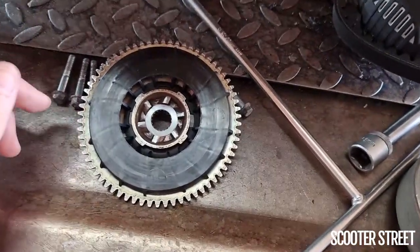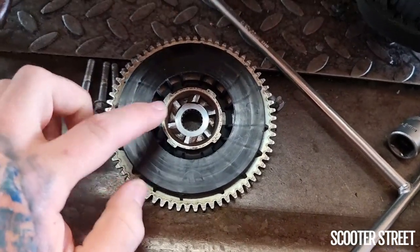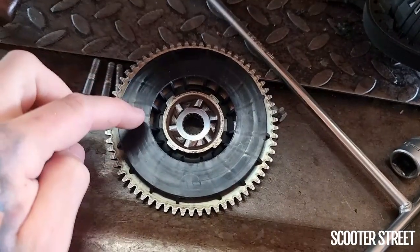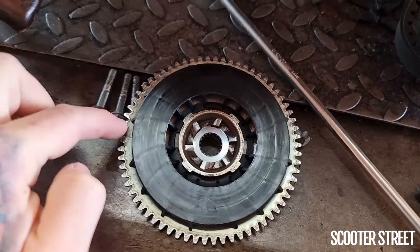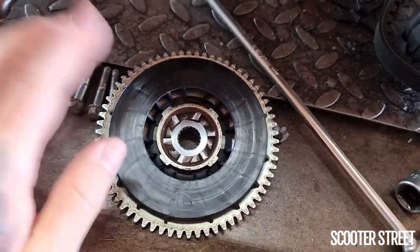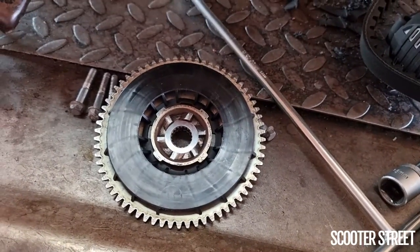Say your belt's a little bit old and maybe something goes into the transmission — a bit of dust, something like that — and the fan blows apart. Suddenly that fan is no longer playing a part in the spacing. Say that fan was adding half a mil of spacing between the star washer and the outer pulley — that half a mil is all of a sudden completely gone, and you have half a mil of free play movement on a bike that might be doing 8,000 RPM.